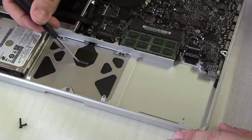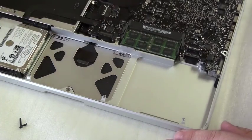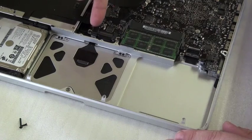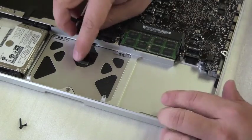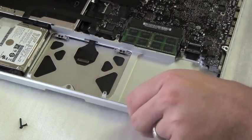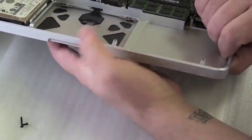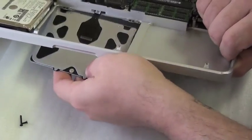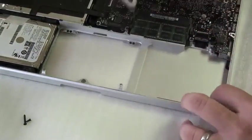Next, lift this lever gently up. Then you can take the cable out, or lift the cable up and slide the whole thing out. In this instance, I'm going to go ahead and replace the cable. At this point, you can just lift this top case up and slide the trackpad out, feeding the cable through the hole as seen.